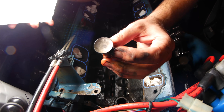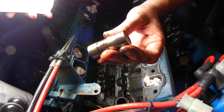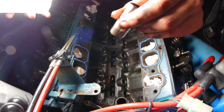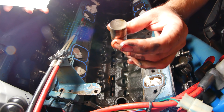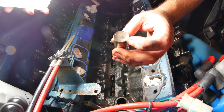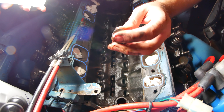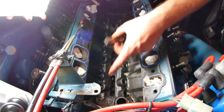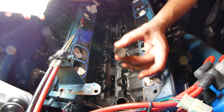Here's a crazy one. Look how curved it is. This is why you need that zinc additive — when the tappets go against the camshaft they push so fast it causes wear. These spin in their bores, and they'll start developing a rounded wear pattern if there isn't enough zinc in the oil. That's not only on the valve lifter but also on the camshaft, which is the whole reason I have to pull this camshaft out. That's the next step — and I'm terrified but really excited at the same time.